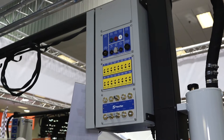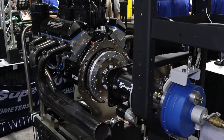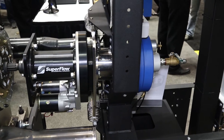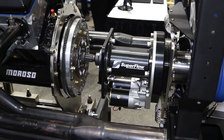After we've done that and made sure it'll stay inside the engine, we've got to strap that engine down to an engine dyno. Tuning is more important on an engine dyno than people think — you can really fine tune fuel injection mapping or get the right jets in your carburetor. The engine dyno allows us to quantify what the engine's done now that it's together. We can simulate going down the back straightaway, or step the motor to simulate what we need for fuel injection tuning, and measure anything about the engine to understand what's actually happening. It's the next step to make sure it does what we expect, so when it gets into the customer's car, it runs like we want it to.